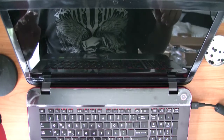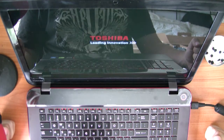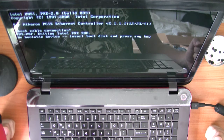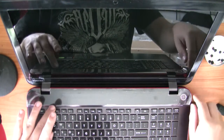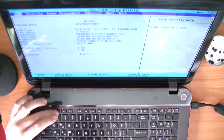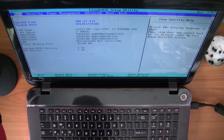Time for the first run — powering it up, opening it works. I know it works because this is a post-repair recording. First thing it does is — it didn't turn on properly at first, and this is because I had it in CSM boot mode. It also might be because the battery was pulled from the BIOS. Once it's in secure boot mode it works fine. On your first boot you should still open up the BIOS and check that all your hard drives, your RAM, and everything are being read properly and present and accounted for.